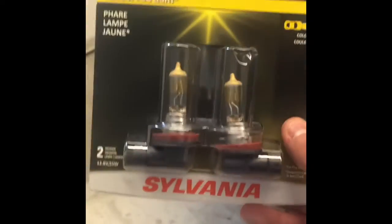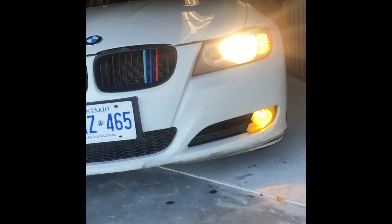So here it is. The way we gotta do it, you gotta turn the steering wheel. You gotta turn the wheels the other way. You remove this one. There's another one here, and then you remove one right here. So you remove those three, lift it, and you're gonna be able to get at the fog light. So let's get to it. Brighter, sorry about that.